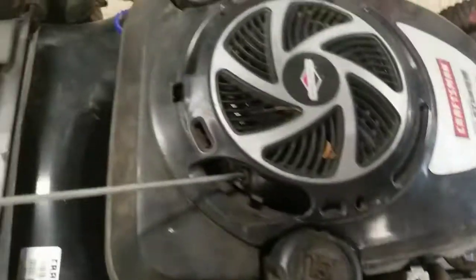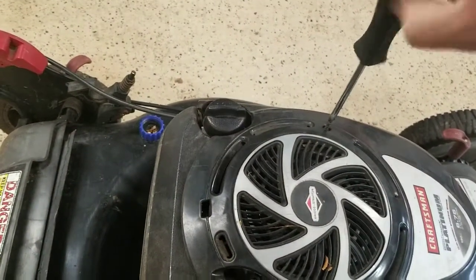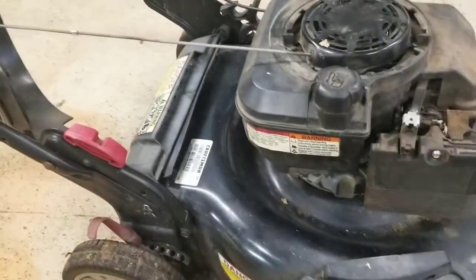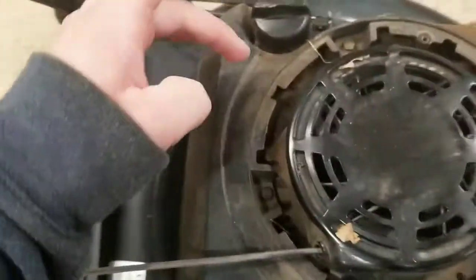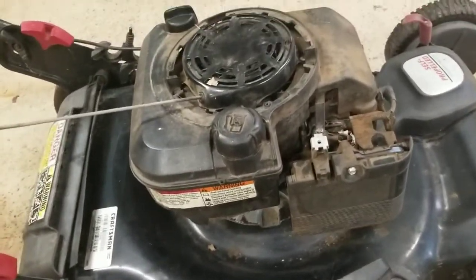That plastic piece is mostly decorative and comes off easily enough. I can do some of this on camera, but some of it I'll have to stop the video since I don't have my good camera and tripod. One thing that makes it easier is to take the handle down. There are one, two, three little bolts to hold the fuel tank on, and the fuel tank has to come off. Then there are four small bolts — one here, one here, and two about here and here — that hold the whole cowling and recoil assembly on.